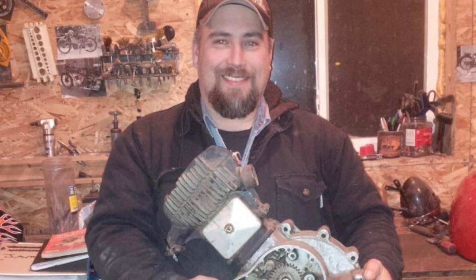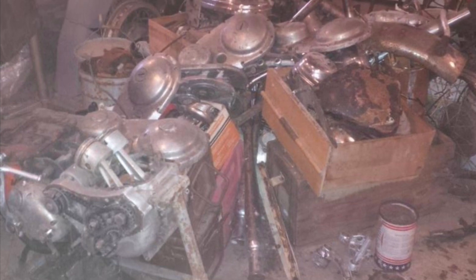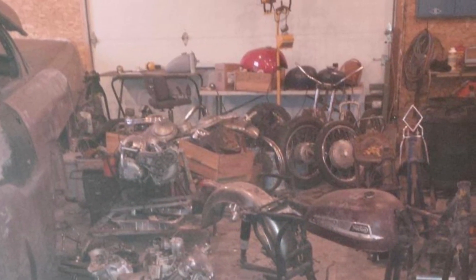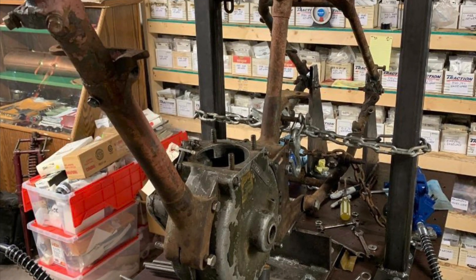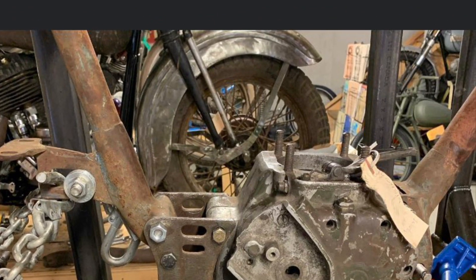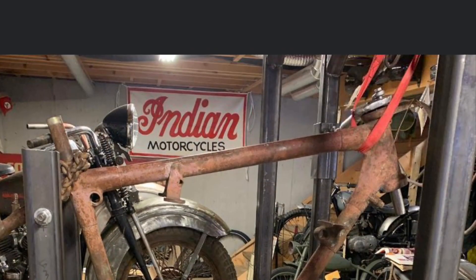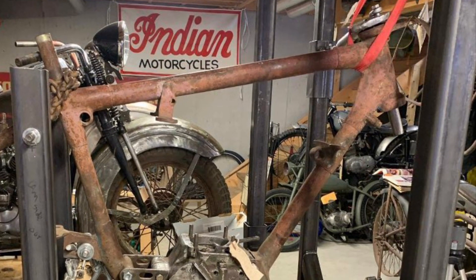There is a lot of work when building these bikes — just identifying the parts is a tough part of the whole process. What you'll see now is just the piles of parts I picked up from that one find. One of the things I had to do with my second chassis was straighten it. Here it is on my frame table — I didn't get too serious into making custom mounts since I was only doing the one frame, so I used chains to hold it in position, but it worked and I was able to pull the chassis into shape.